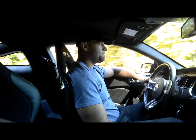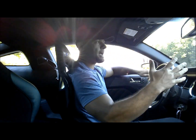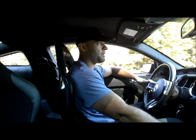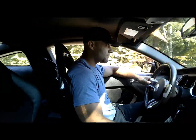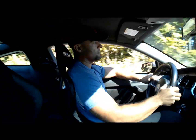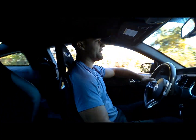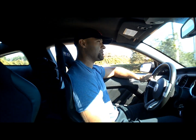Okay, right now I'm rolling, I'm going about 30. I'm going to put it in second and let it wind out. Now the tires won't be spinning, there won't be crazy misalignment going on with the shifter, so I should be able to get it in third, no problem. Here we go. Still spun a little bit, but I was still able to get it in gear. It wasn't jumping around, bouncing off the rev limiter that much.